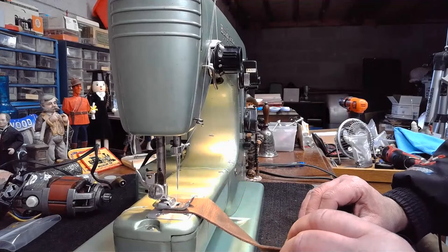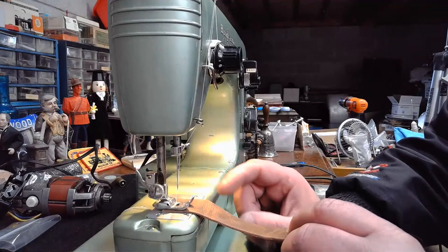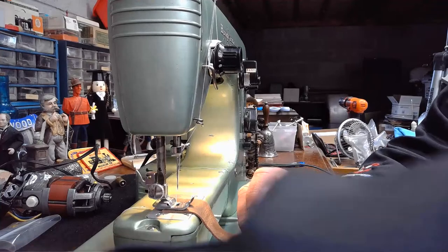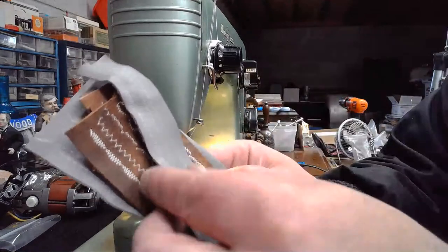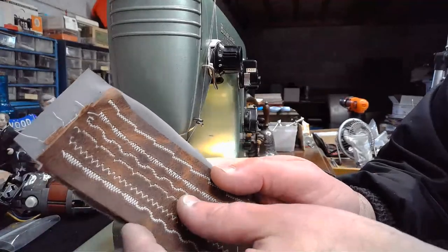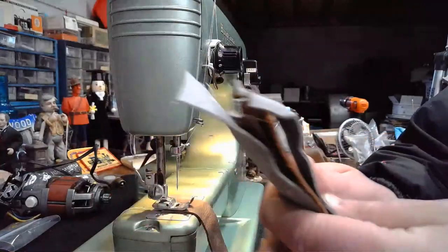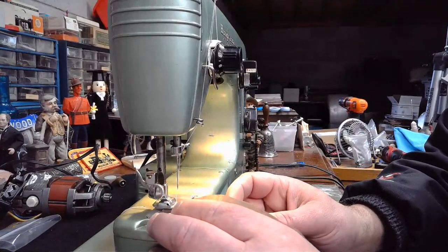Okay. So about 3 to 4 ounces of saddle grade leather, we're laying down a straight stitch to start. And then we're going to launch into a zigzag on this saddle grade leather. And then eventually we're going to move into some protected full grain leather and have fun with the decorative output of this machine as well. And you can see, getting ready for this premiere after battling all the things with this machine, I've already done a number of sew-offs. This is a type of protected full grain leather, saddle grade leather, genuine elk hide, and then finally another version of protected full grain leather as well. So I've already kind of run it through the paces and put that machine and the needle through the races and through the paces.